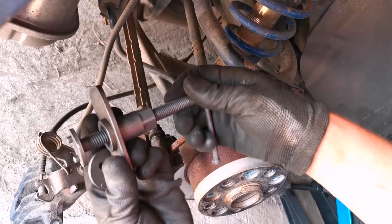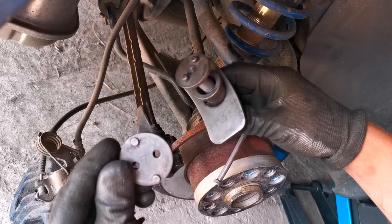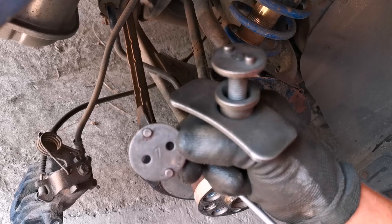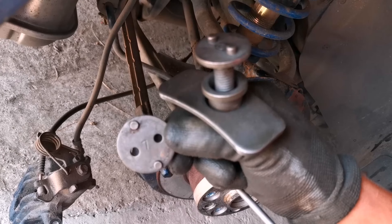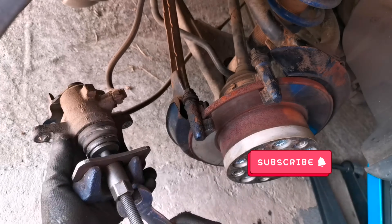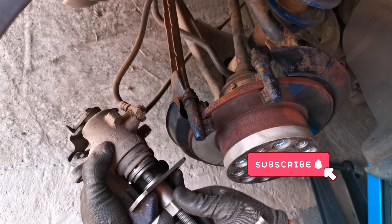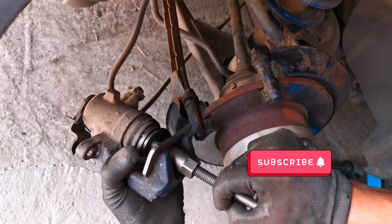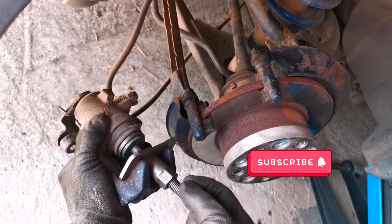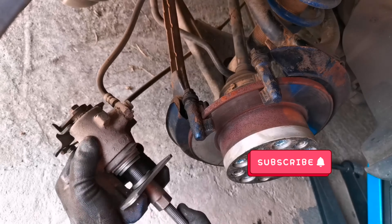Now, in order to push the caliper piston back onto its place, you will need this key and the key that I mentioned at the beginning of this video — you will need a size number 7. In order to make this work, you have to put your press inside the caliper, then tighten it a little with your 22mm key, and you also have to tighten it while turning the piston at times. Just make sure you don't break the rubber around the piston.